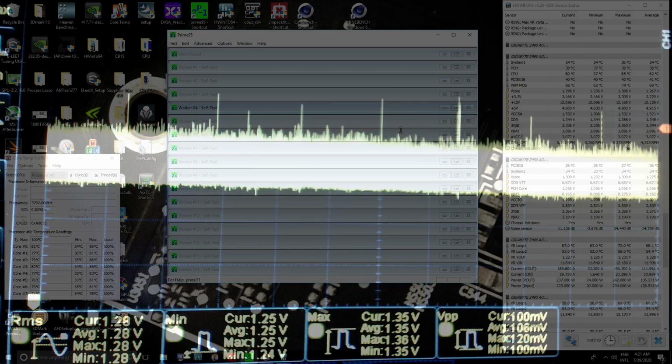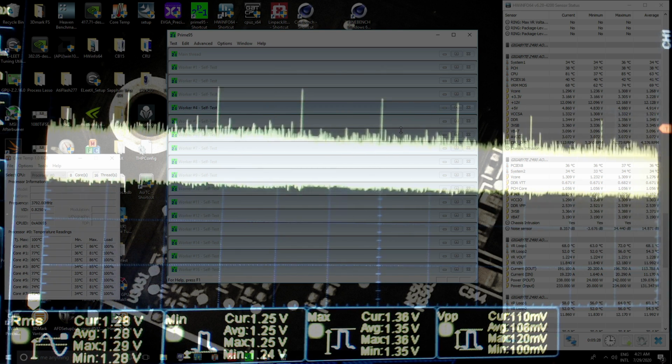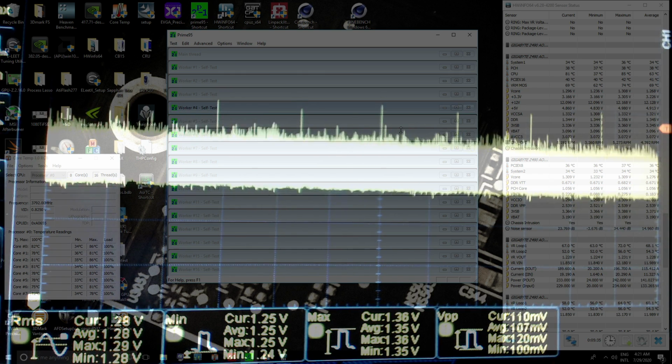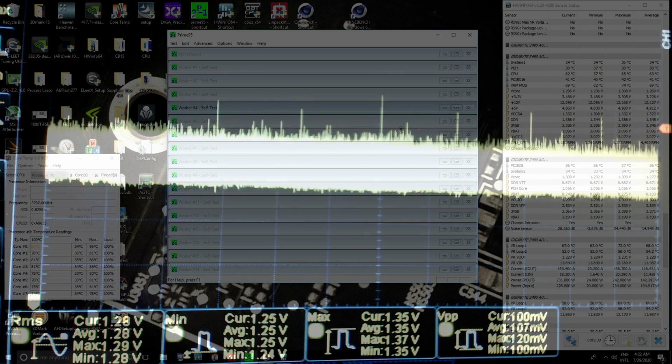But anyway, I don't actually care about that. I don't care that much what rate it is. It's just that spike is normal. That's just Windows doing Windows things. Now, when you're running Prime 95, the spike goes upwards instead of downwards, because when you're sitting idle on the desktop, your CPU isn't doing anything, and then Windows goes, hey, event timer, we need to check if there's anything to do.